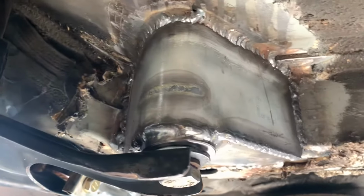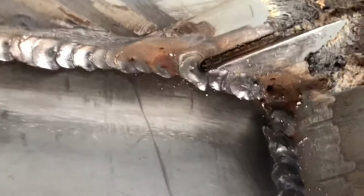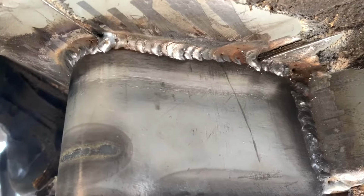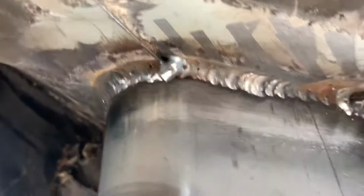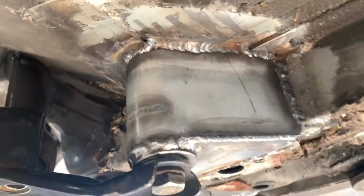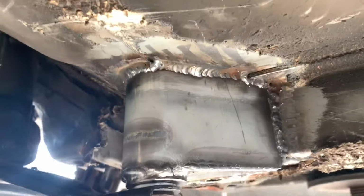And there we have the section welded in. This stuff is not very easy to weld. Over there you can see where these transitions are. There's a lot of material in between over there, and that burns up into your weld, so you need to be very careful. Compared to my finger, look at how much we're nitpicking. So this is very good. It's very good penetration for as far as it's possible with welding on such thin material. So I'm kind of happy with that.